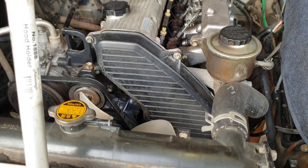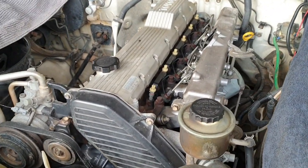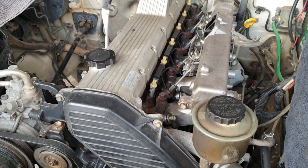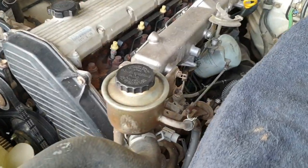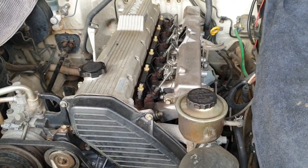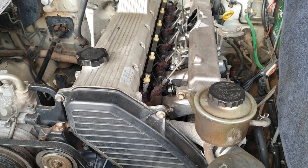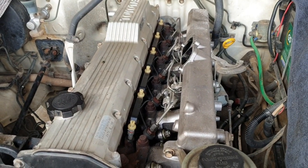All these great big plunger pumps and big high-flow nozzles and all this sort of stuff, as far as we're concerned, are BS. Maybe if you're talking four times the output of the motor on some weird custom rig, maybe — but other than that, a complete waste of money. It's more like having a chrome dipstick on your car. Your fuel system could blow this engine up already standard many times over, so no need to mod anything — just rebuild things properly and use genuine new parts like we do, the Denso nozzles.